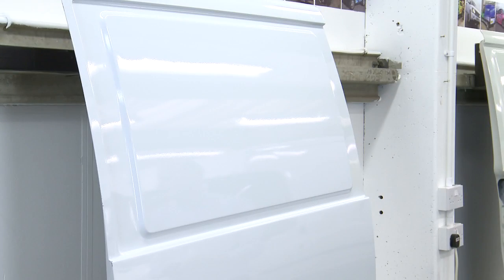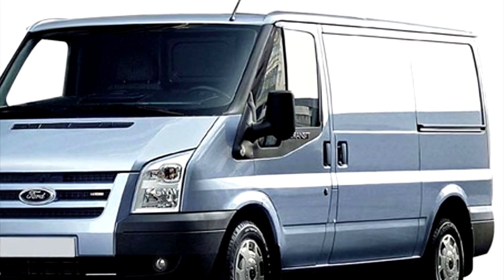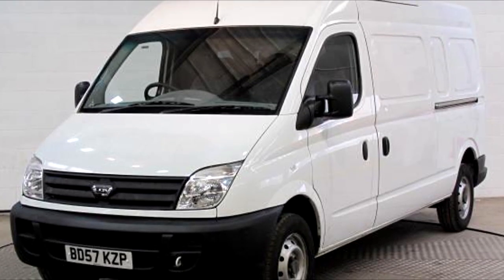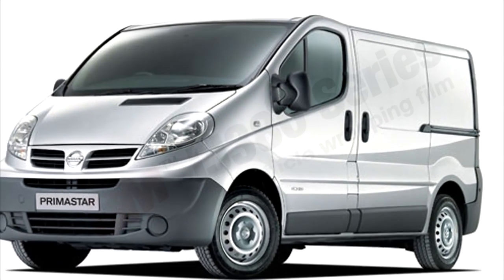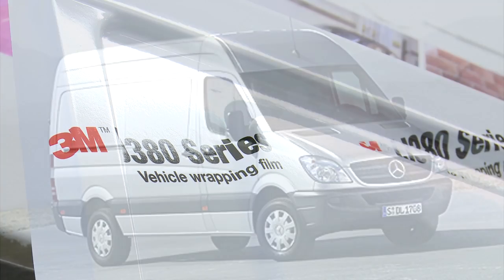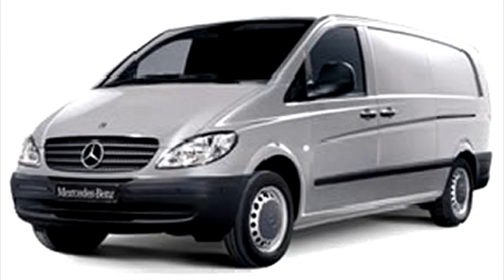Recesses come in many different forms, from shallow single-step recesses to deep U-shaped recesses. Step recesses and U-shaped recesses are not the only differentiator — the angle and rake of the recess are big factors. The tighter the angle, the less surface area the adhesive has to hold onto. 3M have developed films designed to be applied into these areas. 3M Control Tack graphic film IJ380 is designed specifically to cope with the most challenging applications, including the deepest recesses found on vehicles such as the Mercedes Sprinter and Vito vans.